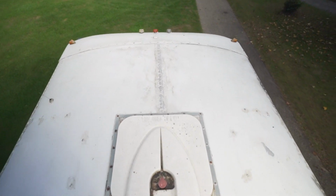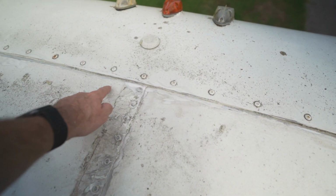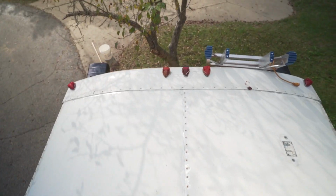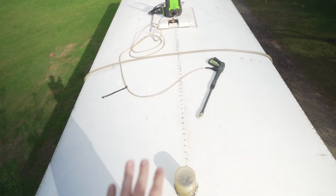So completely sanded down. Boy, some really rough spots in some of these areas, which I'll be pretty excited to reseal. These edges, which again, aluminum, and then this is an actual fiberglass cap. I'll recaulk all that with some Sikaflex. Try to get this sealed and primed in as many spots as I can, so when I'm ready to put down that Enviro White, we've got as much down on the roof as we think we need to have in terms of primed, no rust.